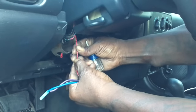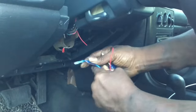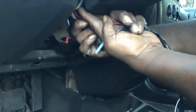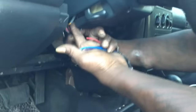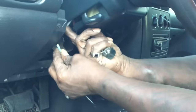I clipped it. Bingo — it went right there like that. And then the blue wire, this blue wire, went to this yellow wire right here. See the yellow wire right here with this thing on it? This is to the starter and ignition. So with this being hooked to this, this would remotely disable the starter. That's how they do it remotely.